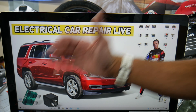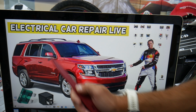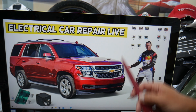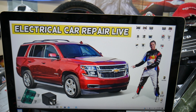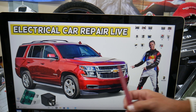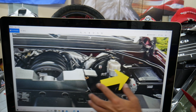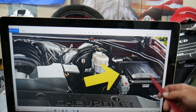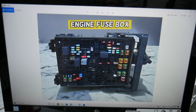There are five different fuse boxes in that SUV and most owners do not know where they are located. That's okay — that's why we made a special video on our YouTube channel about fuse box locations on the Chevy Tahoe and Chevy Suburban. Now, what we need to do first is open the hood. Under the hood, here on the driver's side, you're going to have a fuse box. Open that cover and you're going to find a fuse box with a layout like this one here.